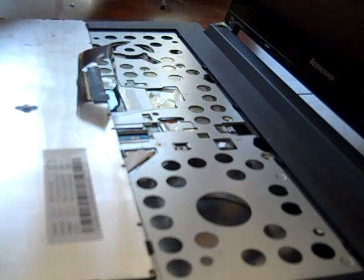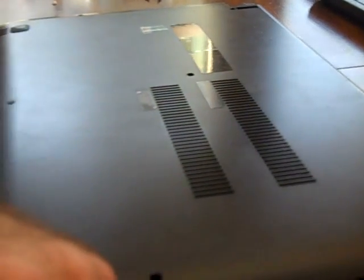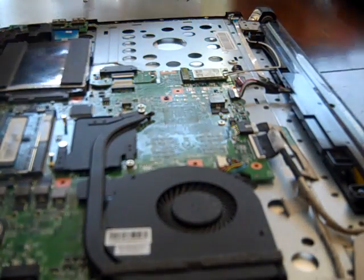We slipped that out the side, which was important because — folding this over and flipping around — the answer is that underneath the CD-ROM drive you have these tricky tiny wide-head flat screws. You need to get these three screws out, and now this is where we're going to pick up in real time because I haven't gone any further than this. We just start prying around the edge and we can lift the back off of the laptop.